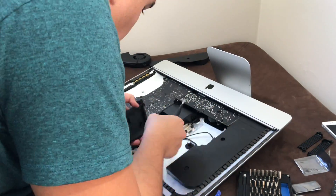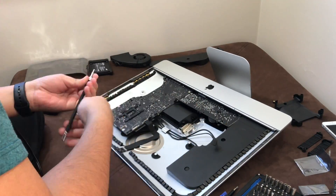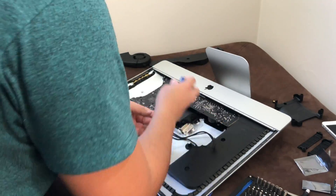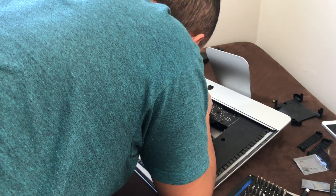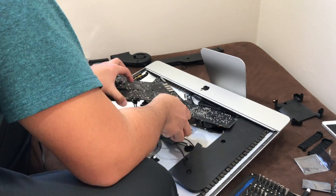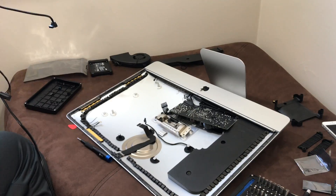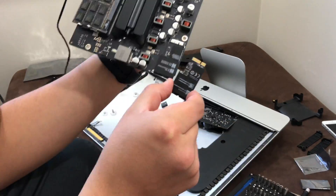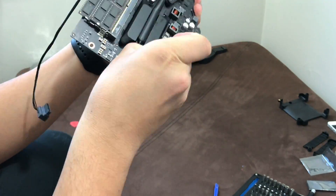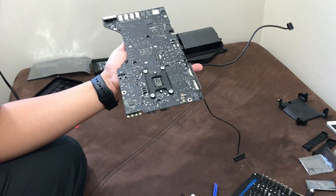What I'm doing right now is just taking it apart, following a video myself on how to do it. I took the screen off beforehand because that does take a little bit of time initially. When you remove it, as you can see, the black outline has double-sided tape on there. At the very beginning of the video I showed a little red tool — basically you just dig it into the gap between the metal frame and the screen, roll it around, and you'll break that double-sided tape. Then the screen is just connected by two cables, so I put it off to the side.